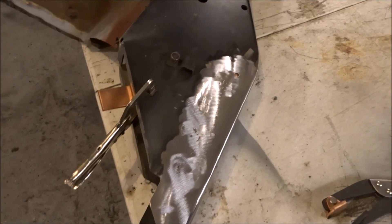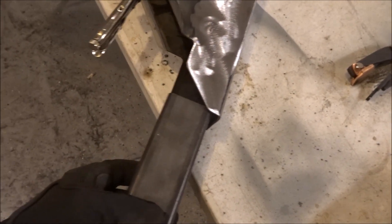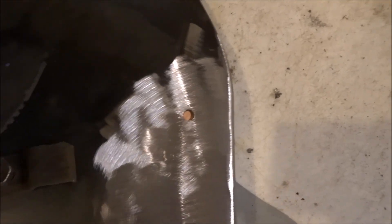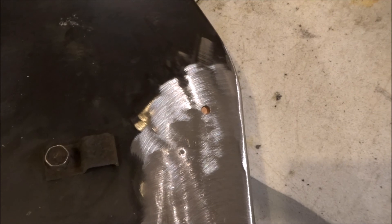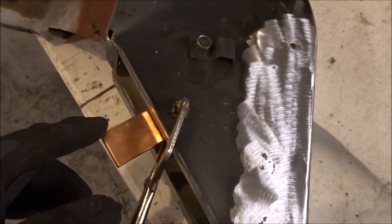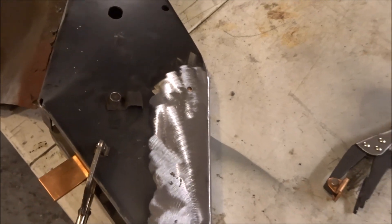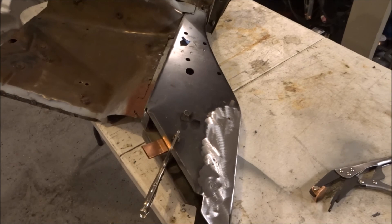There's a little bit of damage from taking them off the car — a small hole. I've got a piece of copper plating going all the way back there. It's 100% copper. The reason for that is I'm going to do that mod where I'm running two-inch square tubing through here all the way back, ending roughly in this area. If I have slag that builds up on the other side as I weld the hole closed, I'll run into an issue getting the tubing down there. Since weld won't stick to copper, if it tries to drip down there the copper will stop it, then I'll pull the piece out. I'll hit that with the MIG, grind it smooth, and you shouldn't notice it was ever there.